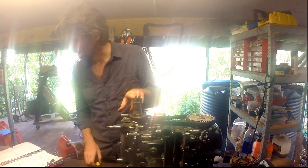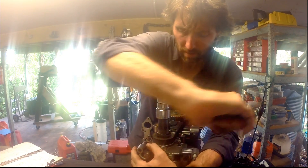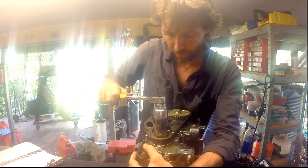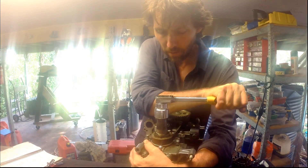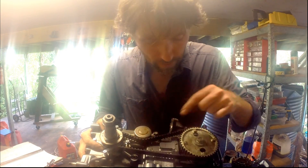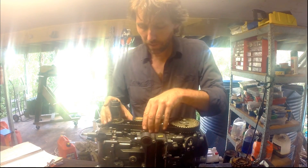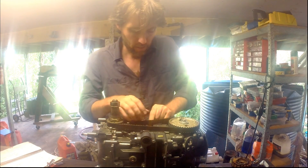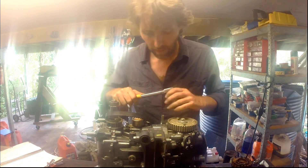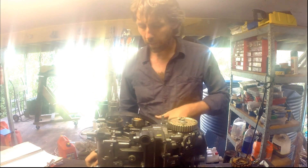The manual says once it's in place, tension it by turning it at least two full revolutions. I'll hold this in place and let it spin a few times, then bring it back round to top dead centre cylinder one. What we've got here is I'm at top dead centre cylinder one on the crankshaft, but I'm at least one tooth out on the camshaft. So I'm going to have to do this again — no biggie. Got the tensioner all the way back, so I can get this off pretty easily. I'm going to leave the crankshaft on top dead centre and just tweak the camshaft back to top dead centre.